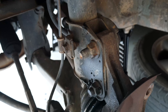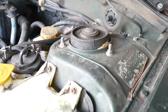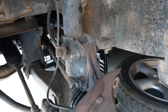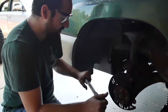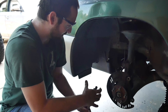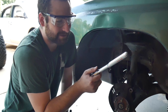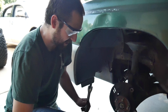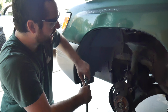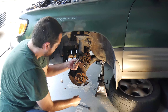To get to the coilover we need to take out two lower nuts attached to bolts that go through, while also removing the three bolts at the top inside the car. I finally got a real breaker bar. I had just been using a pipe on the end of a socket wrench as a cheater bar — that can work but it can be very dangerous and break the tools. At $33, I said screw it and got the proper tool for the job.